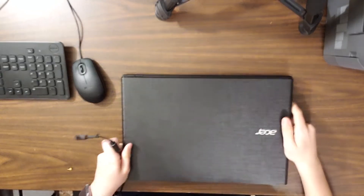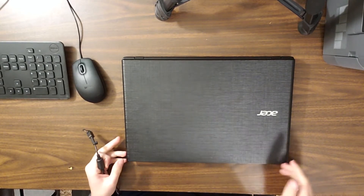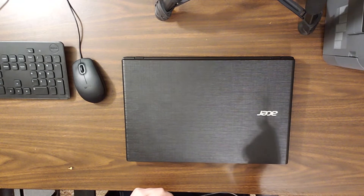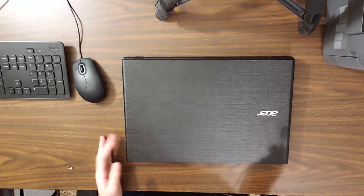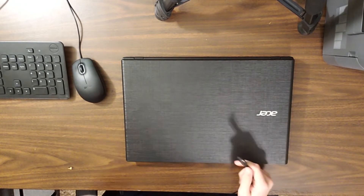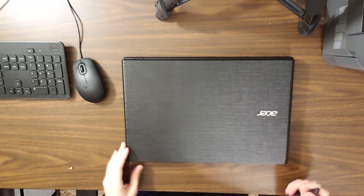That's why I started making this video. Sometimes you have to reseat the actual battery. I actually haven't charged this battery in a pretty long time — this was my daily driver for about two years, and I've owned it for almost four years now. The battery can get so discharged over time that it just starts being unrecognized by the BIOS, by the motherboard, by the operating system — all of that.